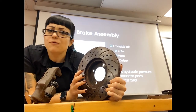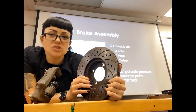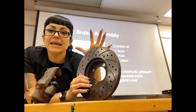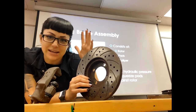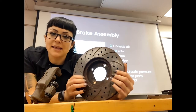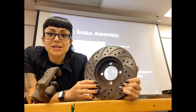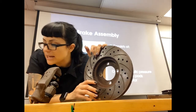Any design for your brakes is going to have friction at its base. That's how we stop the car — by utilizing friction to transfer kinetic energy into heat energy. Energy has to go somewhere; we don't just stop the car without creating something. Your brakes are going to take that movement energy, that kinetic energy, and through friction transfer that energy into heat energy to stop the car. That's how your disc brake works in a nutshell.